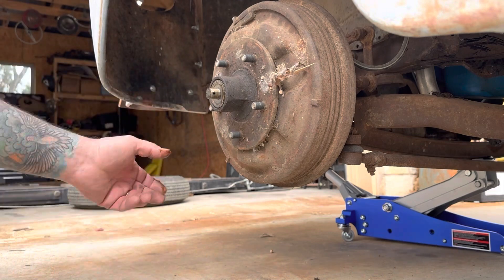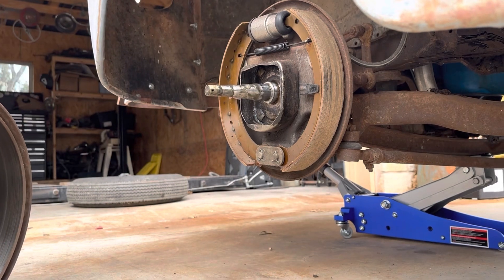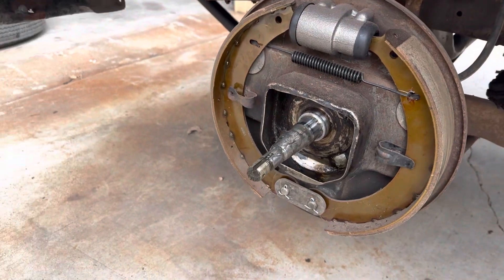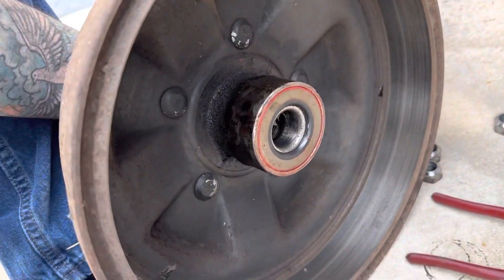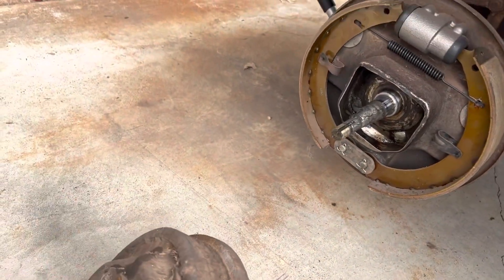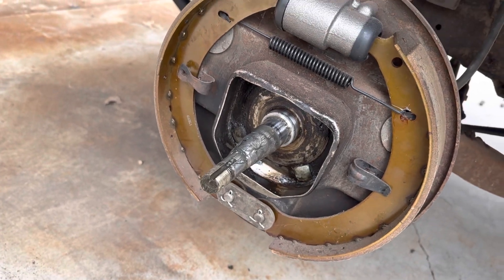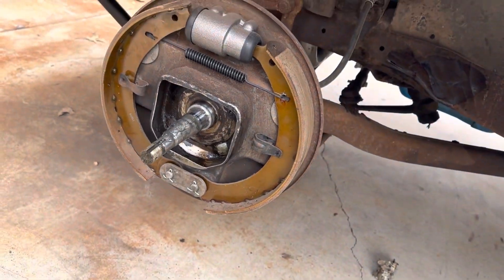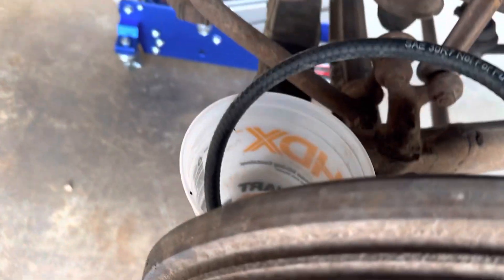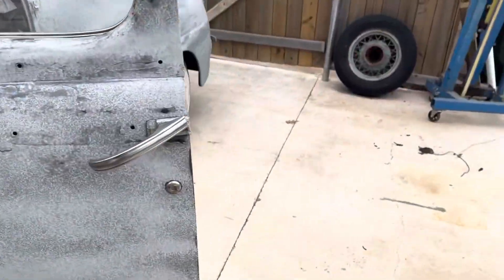These should be repacked every so often anyway. So far it looks good — brand new brake shoes and wheel cylinder, that is awesome. Brake drums have been turned, new bearings and seals — all good stuff. Not quite sure why they didn't paint the backing plate, but I think it'll be fine for now. I've got my brake bleeder all set up with a little cup — now it's time to start getting the air out of these things.